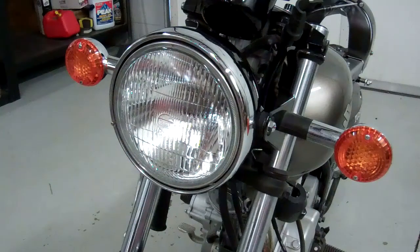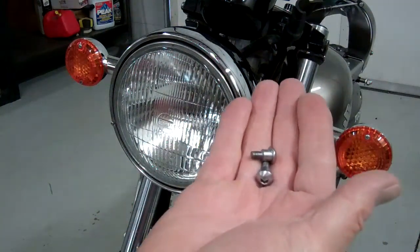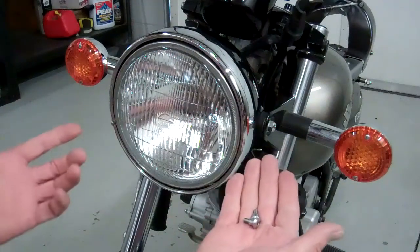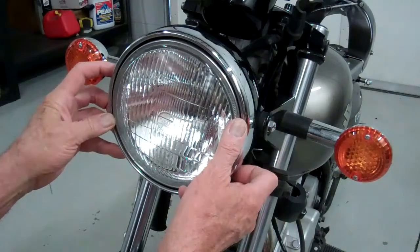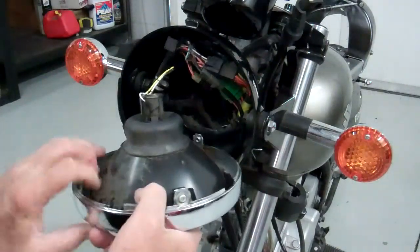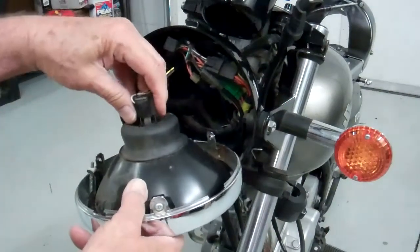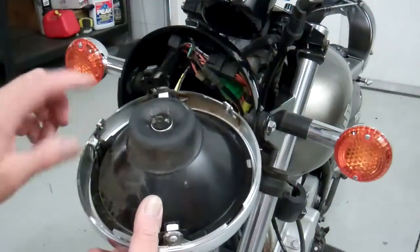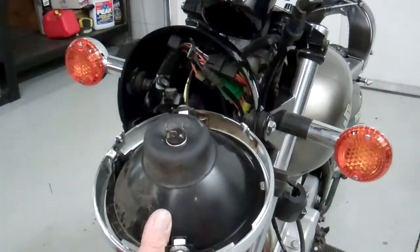To remove the headlight, you just take off the two screws — they're like little button head screws, there's one back here on the black section and one back here. Remove those, then lift the bottom of the headlight out and rotate it clockwise and it should come right out. Go ahead and gently pry off the wire connector. Just for future reference, if you ever have to change your bulb, you can get to it inside this rubber housing here.